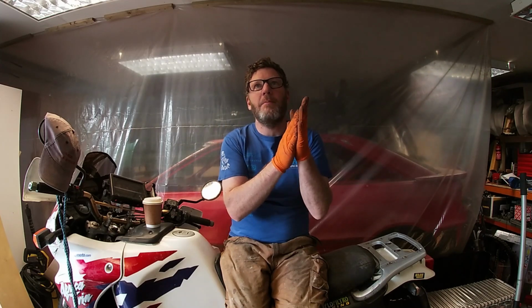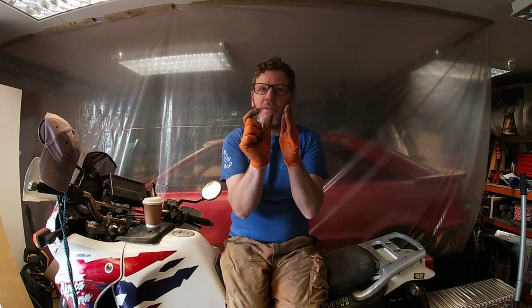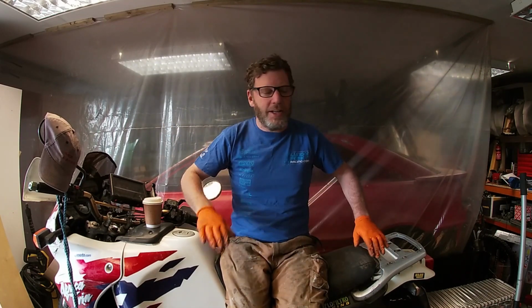One change I did make, I'll show you in a video, is when you offer the plate up to the motor, there was going to be some fouling of the bolts when you brought the bell housing of the gearbox against it, in one or two places. Just to make it all uniform and tidy, I had a 20mm plate to play with, so I countersunk the bolts down by about, I think it was 8 or 9mm. So then when the bolts are bolted up to the motor, they all sit nice and flush out of the way with the plate, and you can just put the bell housing on and bolt them up. It's lovely. You'll see loads of video of that later.